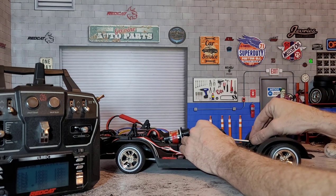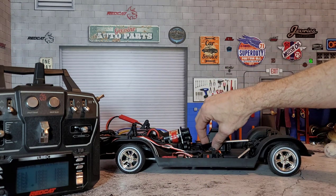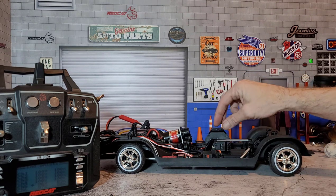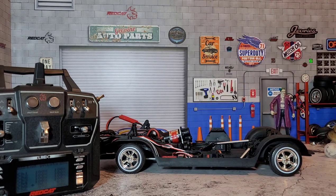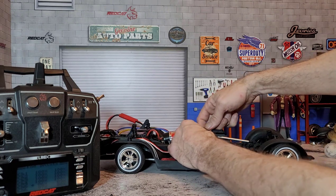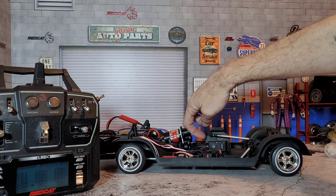So you really need to dial the low side of this servo extremely precisely. Now, it's a little bit harder because we have a plastic servo horn, plastic over here, plastic over here, and there's a bit of flex inside these things. So you have to really look at the point in which the ball makes contact with the arm over here.